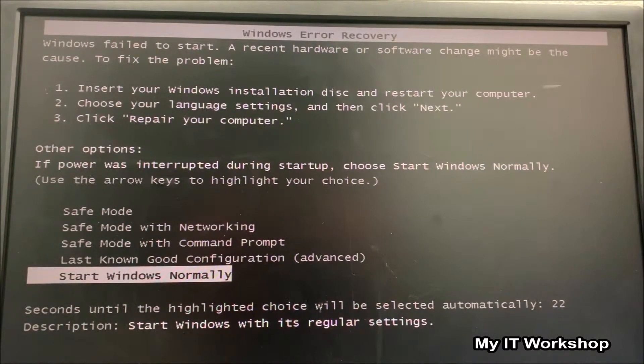This issue can happen on newer computers as well — RAM might fail or not be correctly seated. You should always hear the clicks when inserting RAM; that's the motherboard telling you it's connected correctly. It could also be the CMOS battery or, as happened with another computer, a failed integrated video card requiring replacement. Thank you for watching. If you liked this video, please leave a like, comment any questions below, subscribe to the channel, and click the bell for future video notifications.